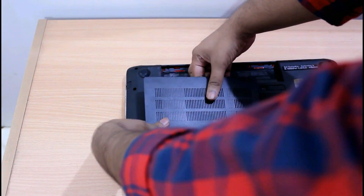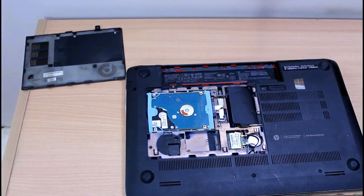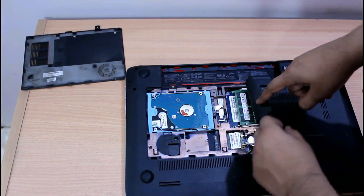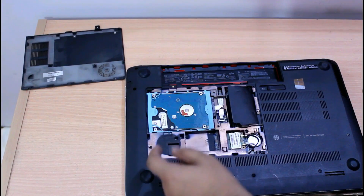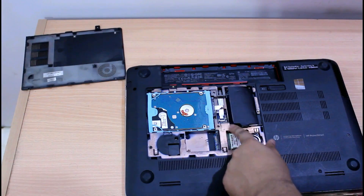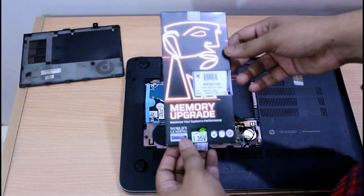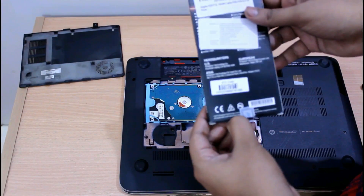It's the first time I open my laptop and I don't have much light here. Now you can see the service bay. This is the Samsung 8GB of RAM, and that is the hard disk. Below the hard disk we have the port for mSATA SSD — it's quite dusty right now. I'm going to install the mSATA SSD later; if you want to see that video, the link is in the description. And this is the Kingston 8GB RAM module that I'm going to put in.